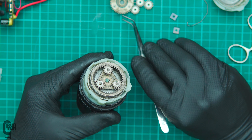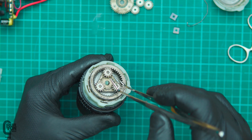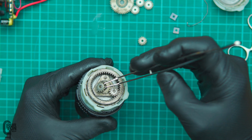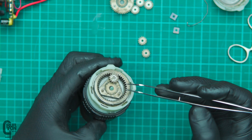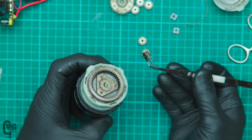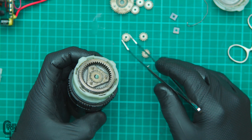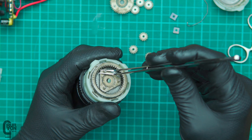And we can just put that down. We can see the next set of little planetary gears. These gears are slightly different to those, so just remember that they come out of the second stage. We'll take that one, put that there, take the second one, put that there, and let's see if we can grab that third one. These also don't look like they are a single direction, so it doesn't really matter which way you put them back in. We'll keep those a little bit separate, and then we can pull out the next stage here.